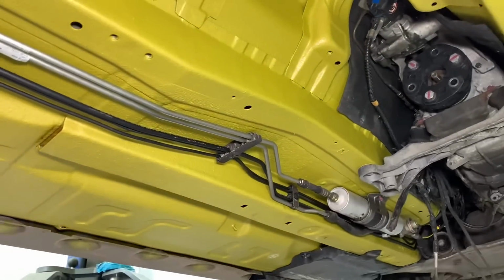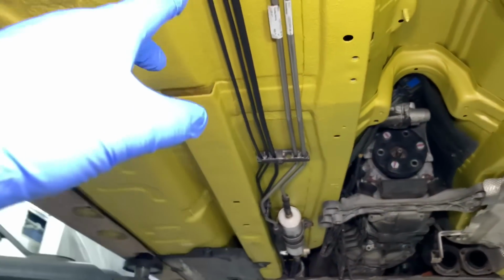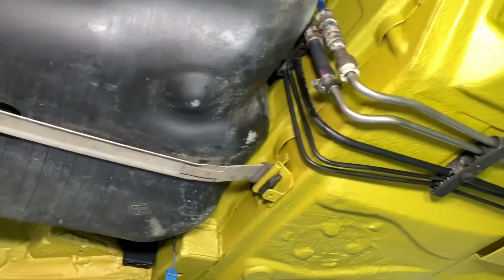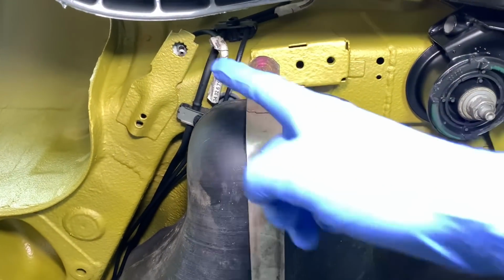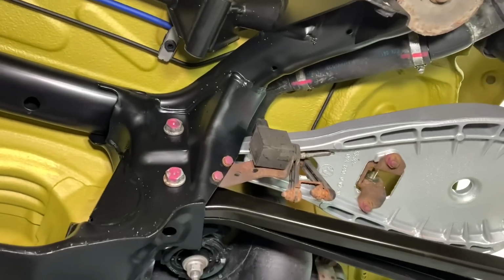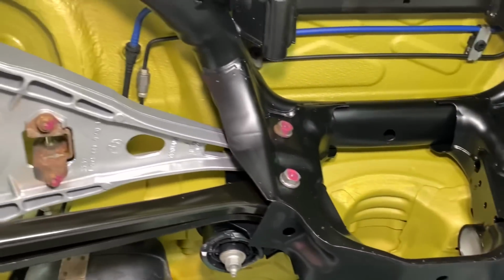We've gone for new brake pipes, front to rear. There's a service joint down in the engine bay there. We've brought those along, got them parallel to the clipping points for the fuel pipe, and then up through the BMW clip pieces around the back of the fuel tank, and coming out to supply the left-hand side flexi just there. And there's a service joint just up there, and the right-hand side one was already done by this owner a while back,